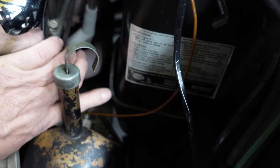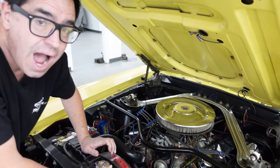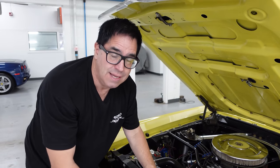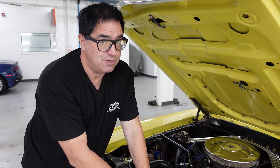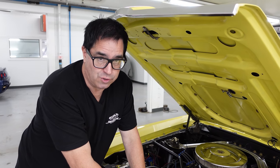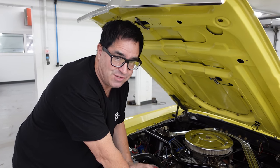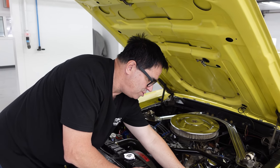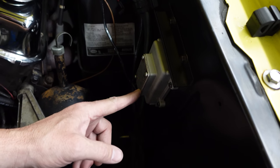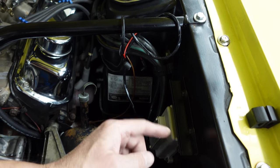That tells us something very important: this was a Boss 302 car, of which only 169 were made. The Boss 302 is gone now — that was the canted-valve SCCA homologation engine, the same engine used in the Boss 302 Mustang. This is a G-code Boss 302 Mercury Cougar Eliminator, or it was. The Boss 302 also had this rev limiter — it's not connected, but I'm so glad to see it still here. This is the Autolite unit set for 6,200 RPM.